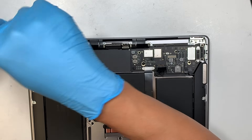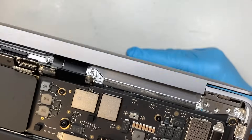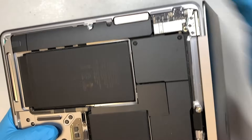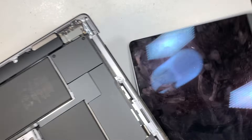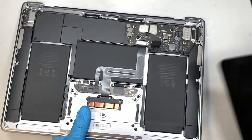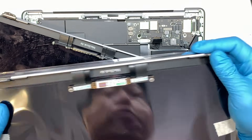We need to remove the entire LCD assembly, so remove three screws on each side using the T8 screwdriver. Once done, open up your laptop and push it more than 90 degrees, then slide the hinge right off the laptop. Tilt it almost all the way back and slide it right off. The original screen is now removed and the laptop base is in front of you.